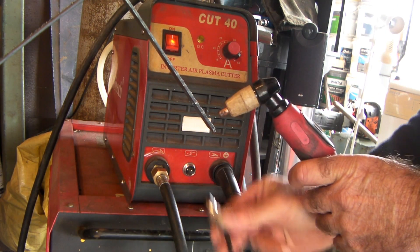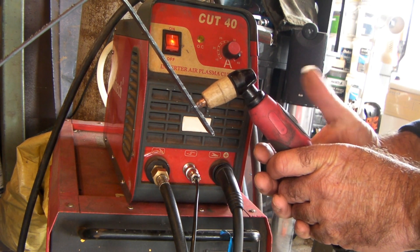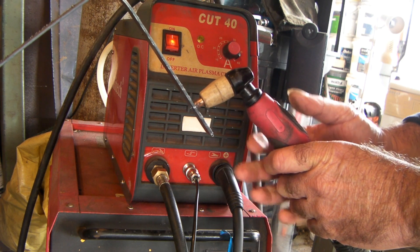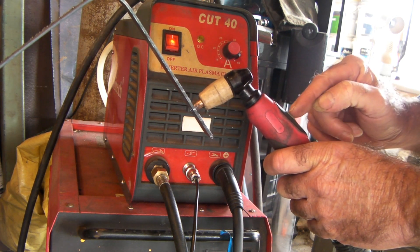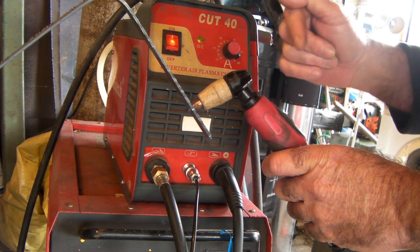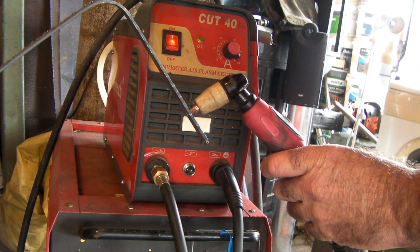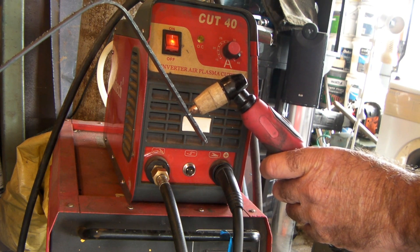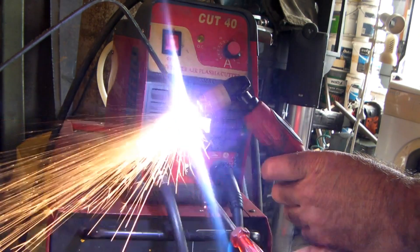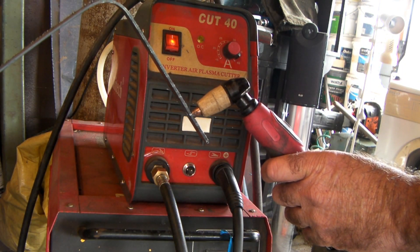See that guys? So if I grab this and plug it back in, and then try to do exactly the same thing but this time use the button - nothing. See? So that's telling me there is a break either in the switch or the wire between the switch and this plug. And if you've got a really long lead like I said it can be a real pain to find it. So once again, just take that out of there, grab yourself a flat screwdriver and touch the two prongs together - there you go. So there we are, we know we've got a problem with the switch.